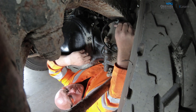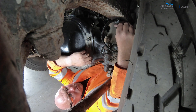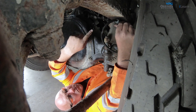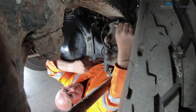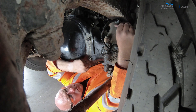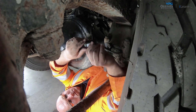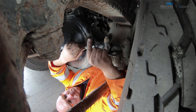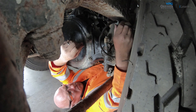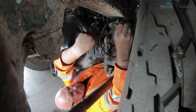When you fit the axle transducer it must be in the correct orientation. The transducer must be placed in a position that is parallel with the chassis of the vehicle, either facing forward or backwards. The transducer is also marked with a groove around one edge; this must always be facing up. Finally, a cable runs out of the rear of the transducer — this must always run away from the closest axle.